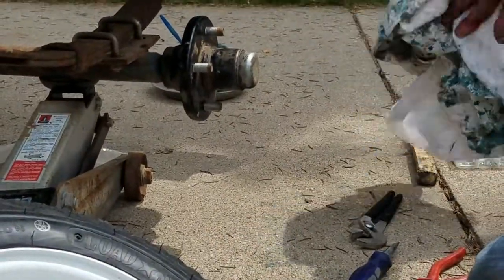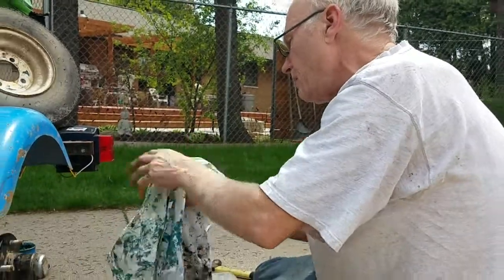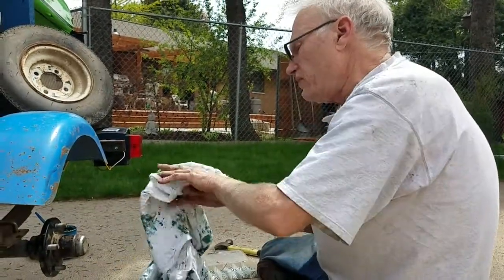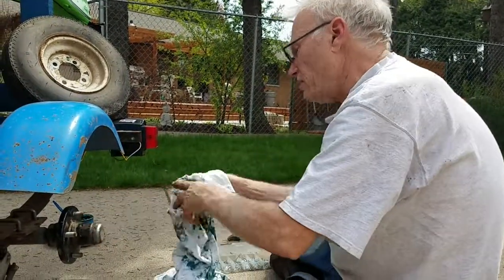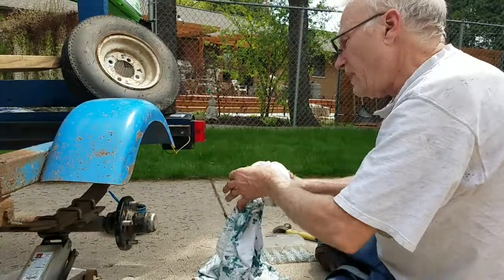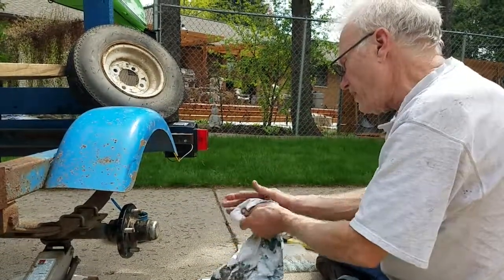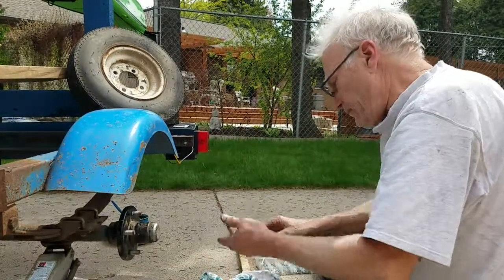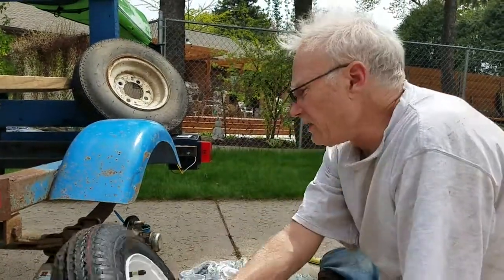The biggest thing is to pack those bearings properly, and in my opinion, do not rely on bearing buddies. If you look inside every hub, you'll see all the grease hardened and filling the void down the center, and you'd have to have an absolute ton of grease in there to get into the bearings anyway. You'd have to have it so full, and it never does that. So you might as well just learn to get your hands dirty and do it like this.